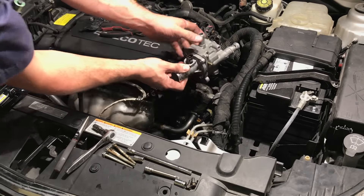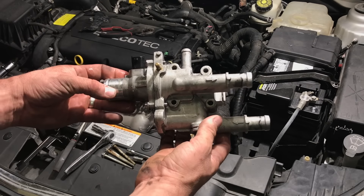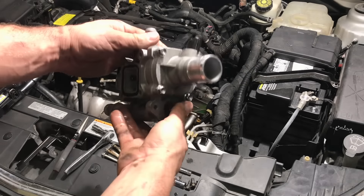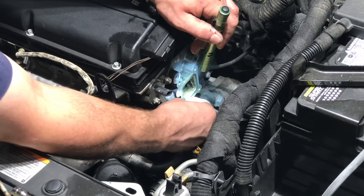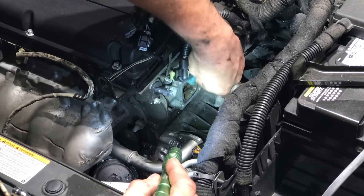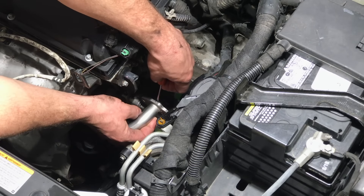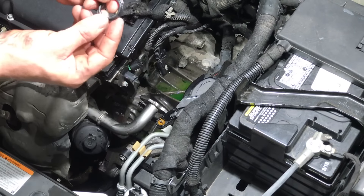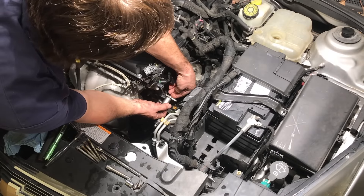As you can see, here's the old thermostat housing — the housing is on the right and the thermostat itself is on the left. This is the part we will be replacing; it's pretty much all-inclusive when you get the whole assembly. Next, take a piece of Scotch-Brite or equivalent and clean the mating surface on the cylinder head where it seals to the thermostat housing — this is really important. Also remove the rubber seal on the end of the coolant pipe and replace it with a new one while you're at it.